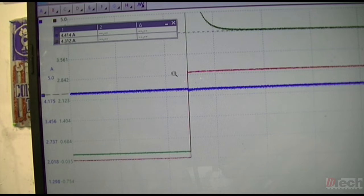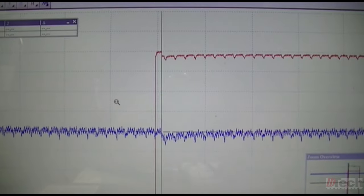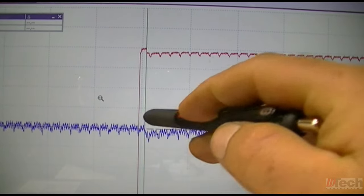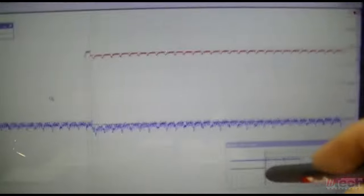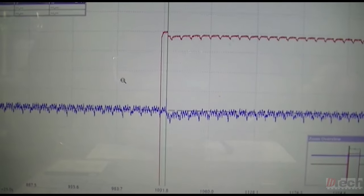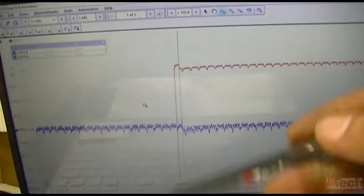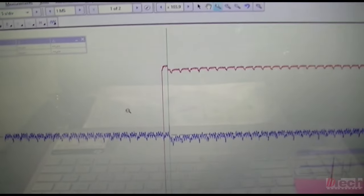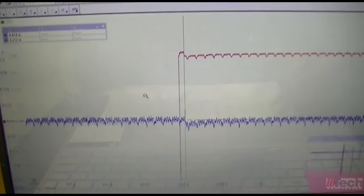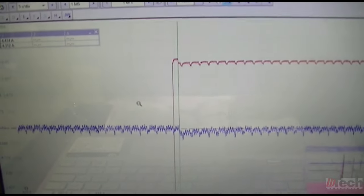The more important, let's look at that feed when we turned on and stayed on. The amperage pretty much stayed similar. You had a little drop, but there is no major change in the way of that would concern me as far as causing any type of danger issue. We're not having a great increase in amperage where we would cause damage to the SAM. I'm not concerned with heating up any wires. I don't see that much of a crazy, worrisome level change to where I believe wires would start to get hot or any crazy situation like that.